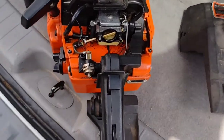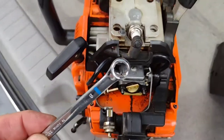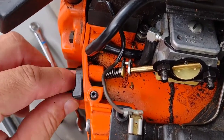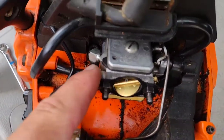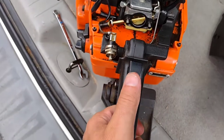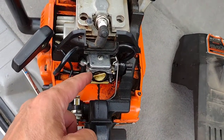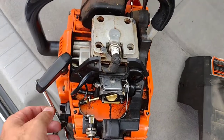Let's make sure we've got everything back correctly — two bolts in and snug. Before I cinch the nuts down, I want to make sure the choke is back in the notch and lined up properly so when I twist it up it's choked. Choke is right, fuel line attached. Checking the throttle — throttle works. Push it down, make sure that locks. Squeeze the trigger — everything is working properly. Tighten the two nuts down, reattach the air filter, and put the housing back on top. Hopefully there's enough fuel to start it up.